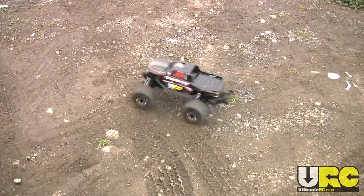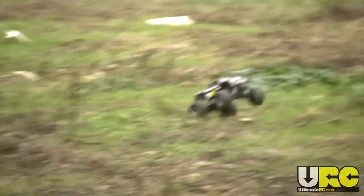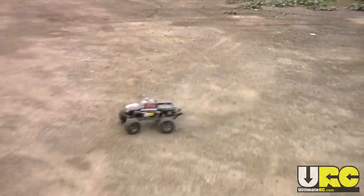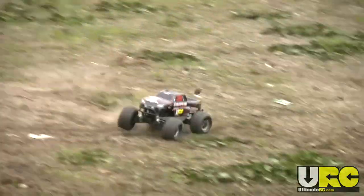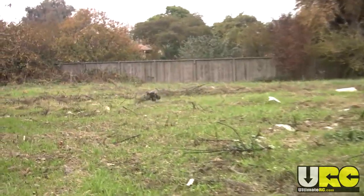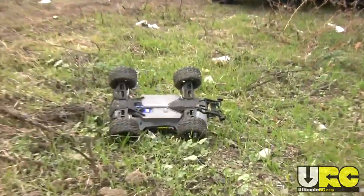It's what comes out of the box even with this relatively slow battery. You can put up to a 3-cell LiPo in without changing anything. You can also re-gear it for a top speed Traxxas claims to be over 60 miles per hour with a powerful enough pack and really tall gearing. Traxxas is getting really good at outfitting their vehicles right out of the box. The suspension setup is working well — it has linear springs, unlike the Slash 4x4 which had those progressive springs. The Slash 4x4 arms are equivalent to the width of the Stampede two-wheel drive rear arms, kind of like having a Jang wide mod on the front right out of the box.